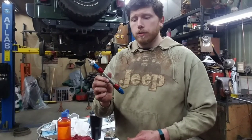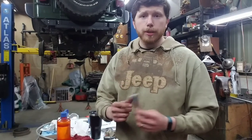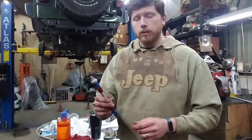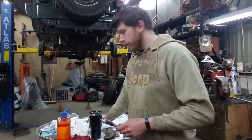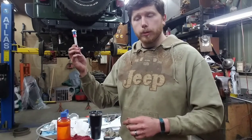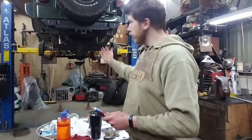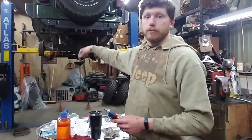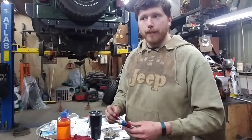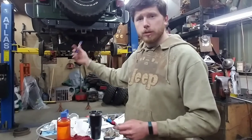With the small leak we saw on this hose, I just put it back in the vise and tightened it down — that was enough to stop the leak. Now this hose is all set. I have another hose that I already pressure tested, so we have one for the feed and return on the motor side. We'll get those installed and everything tightened down, then raise the tank up and start making the lines from the tank to the beginning of the fuel system.